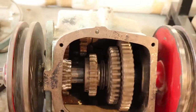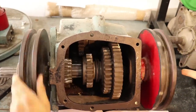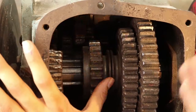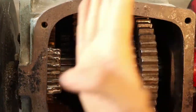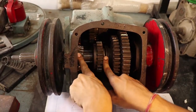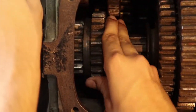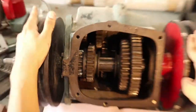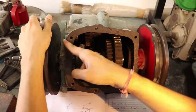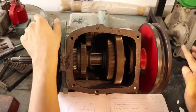This is the third gear — you can see that the speed of the output shaft has been increased compared to earlier. Now let's look at the fourth gear. To engage the fourth gear, we have to directly connect the input shaft with the output shaft. We do this by sliding this gear onto that gear. Now you can see that both the input and output shafts are directly connected via these two gears.